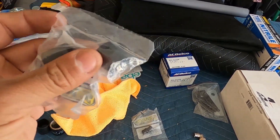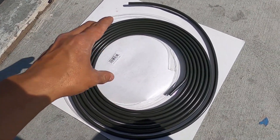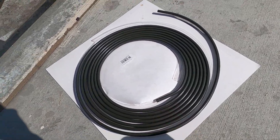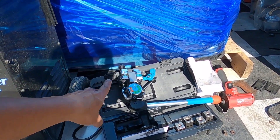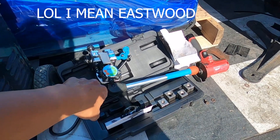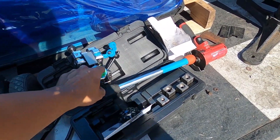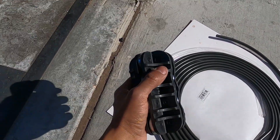We're doing dash 6 today with 3/8 line. When you order line, especially if you're going to be doing your own bends, it usually comes in a roll like this for shipping purposes — that's why you need the straightener. This is Earl's line in the olive color. You're also going to need a flaring tool. This one is from Eastwood with a Summit attachment. There are different angles: 45-degree flares for brake lines and tranny lines, versus 37-degree flares for AN. We'll need that to flare our line, the straightener, and also some welding wire to mock up the line.